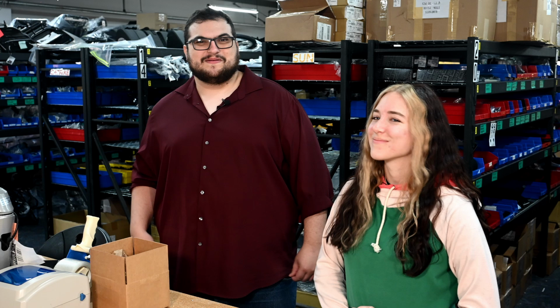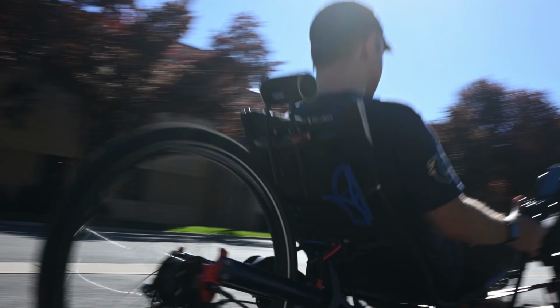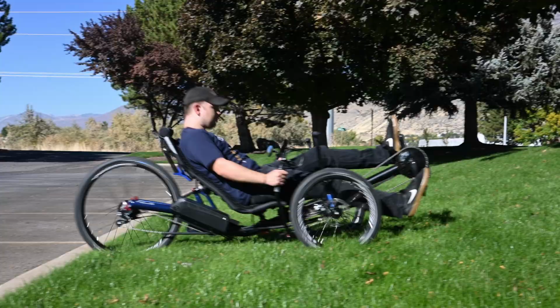Orin B on YouTube asks, will an electric trike climb a very steep hill for 100 yards and do a round trip of 6 miles? Absolutely. And this is one of the main reasons we recommend using a mid-drive motor instead of a rear hub motor. Since you can use the gearing of the trike in combination with the motor, like a car shifting its transmission, you can even get going on a hill from a stop.